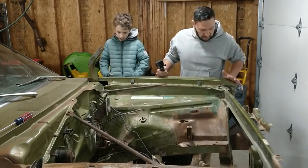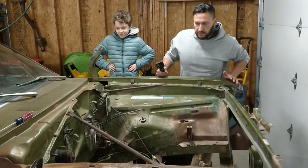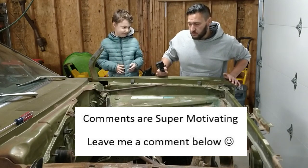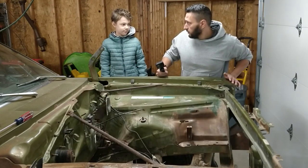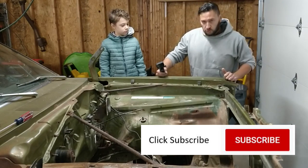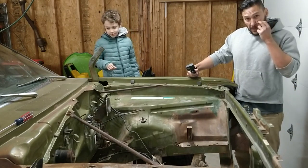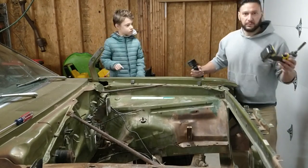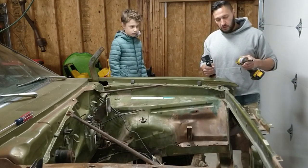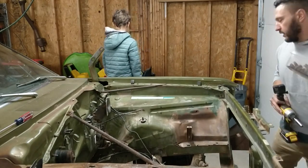We already pulled off the other side and it was a little hairy on some of it, so I wanted to make this quick video explaining on our '74 Duster — I assume it's the same on a lot of these A-bodies — how to pull this fender off. The last bolt is a little tricky to get to, so if you've got a better way to do it, please leave a comment below. We're going to need a half inch and a 7/16 inch socket, and I'll be starting with my driver. We've got a total of 15 fasteners to do.